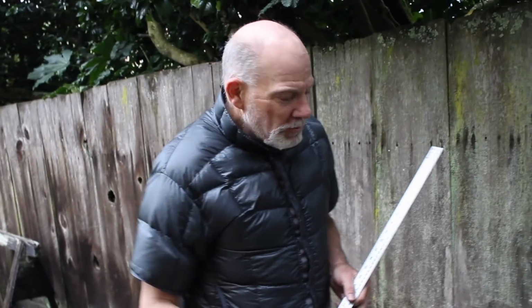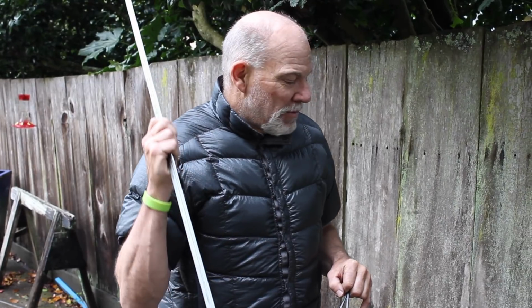That might not affect you, but the general rule of thumb, inseam times 0.885, is the center of the bottom bracket to the top of the saddle. How it feels is more important than the rule of thumb, than the gross generality of 0.885 multiplied by your inseam. How it feels is the most important, and that takes years and mile after mile after mile to figure out. But for a general rule of thumb, it's a pretty good place to start.